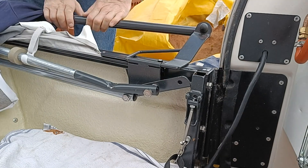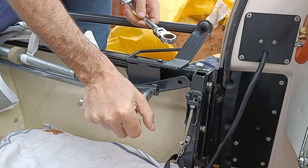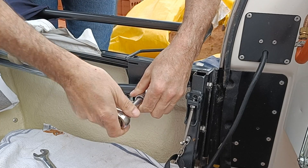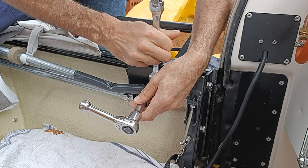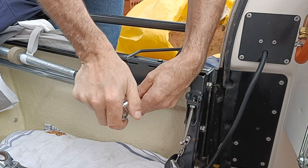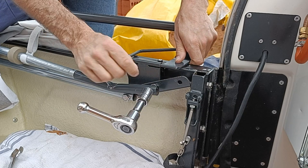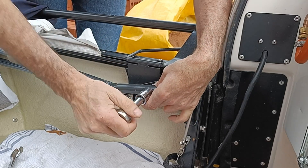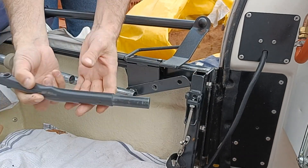So what we need to do — pull that out of the way. Grab my 17mm socket. Some resistance. I'll see if I can get this other one backed off a touch. There we go. You just need to continuously back off that nut whilst undoing the principle nut — in fact, you could probably trap one whilst doing the other. There we go. One old part.